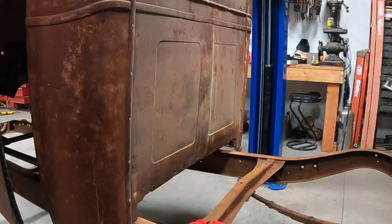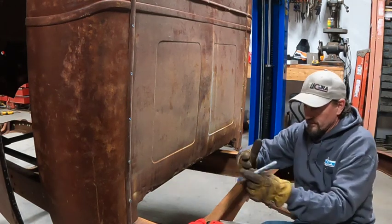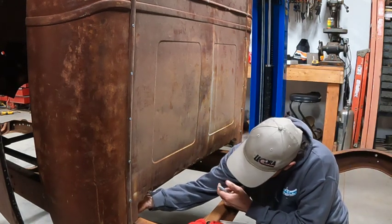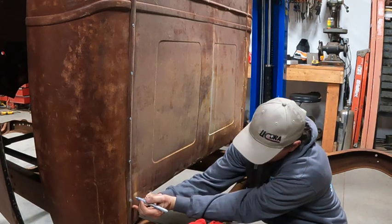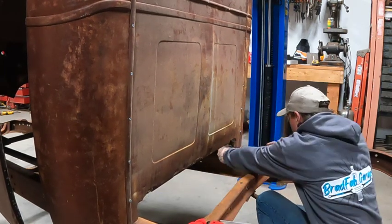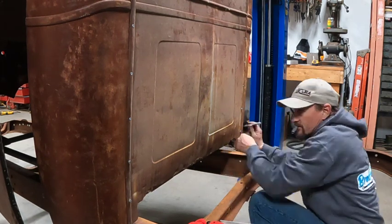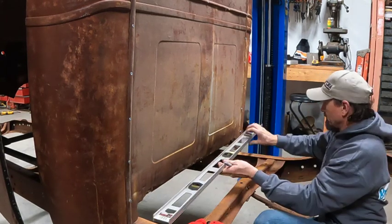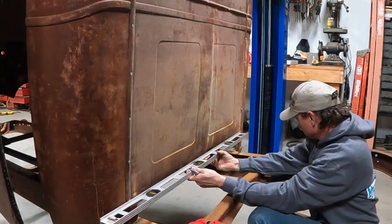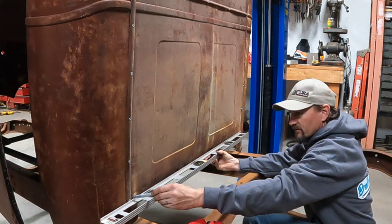I might just trim this up to the floor pan and across, and I can get rid of all this rust. That will set the floor pan close to the body, and then we'll see what we get from there. My new floor structure is right here. Let's connect the dots as crooked as this little truck is — see if we can get a straight line right there. And I'm going to drop down just a hair just so we have some to play with if we need to.